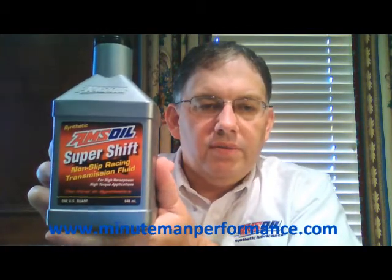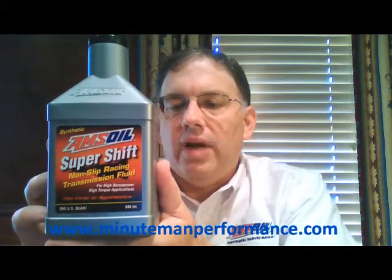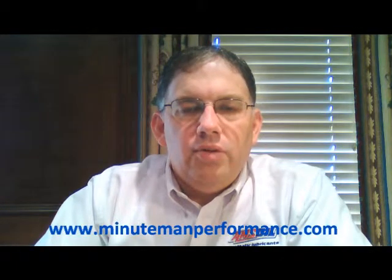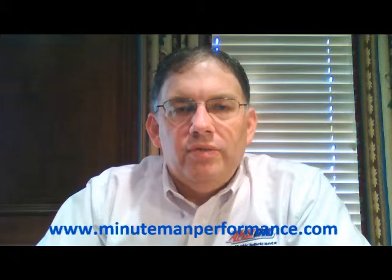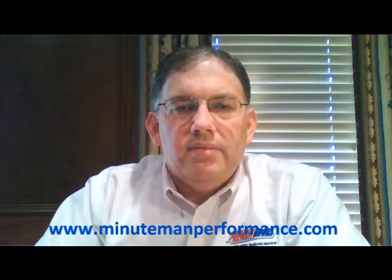This is a relatively old product for AMSOIL because the Ford Type F and Allison C4 specifications are such old specifications. It's not a new product at all — it's been on the AMSOIL inventory line for many, many years. But don't think you're going to pour this into your modern transmission and all of a sudden have improved shift quality for your everyday driving, because you won't. It will give you an unpleasant surprise because no new transmissions are designed for this type of fluid.